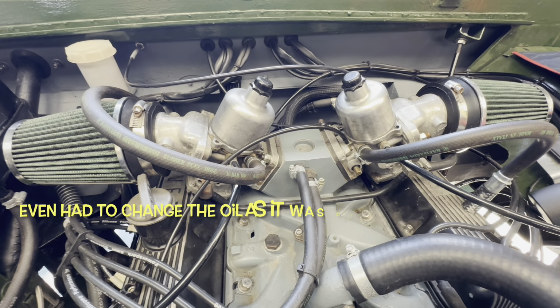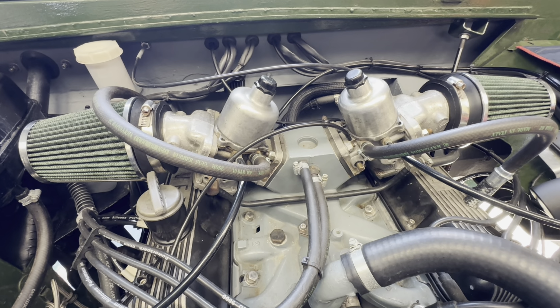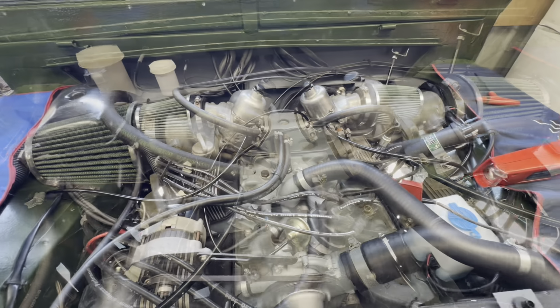So it's got a pair of BAK needles in it, so I pulled them out, put some BBCs in, and now I need to start needling and see if we can get this beast to wake up.